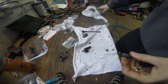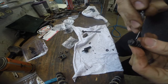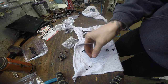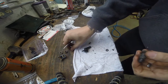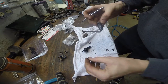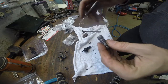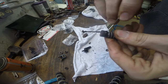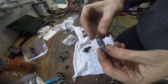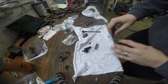I'm waiting for the paint to peel off all this stuff — I've got some stripper on it. We're going to take some dentist picks and pop these seals off. If you notice, this one has a smaller inner diameter — there are two seals, so you want to make sure you put the right one in the right spot. And then you have this back one here — the taper is faced like this. The taper is always faced towards the end of the shaft, or the end of this rod. After popping both seals off, we're going to take some brake clean and clean this shaft. Wait on the paint to peel off our master cylinder, and then we're ready to put everything back together.